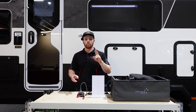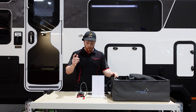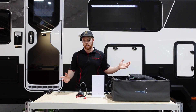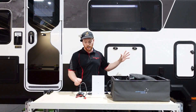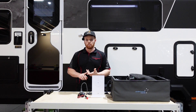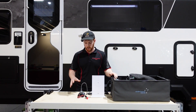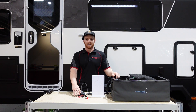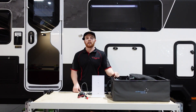That pretty much solves problem number two — powering your Starlink. We do have a couple of options with these inverters: they come with the 12 volt plug pre-fitted so you can plug into any 12 volt plug in your caravan, or we can provide them with a 12 volt wiring harness if you want to hardwire the inverter in your van — whether that be to your BM Pro, a power management system, or direct to your battery system — with all the harness needed to have it mounted permanently in the caravan.